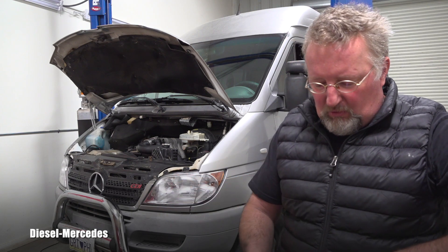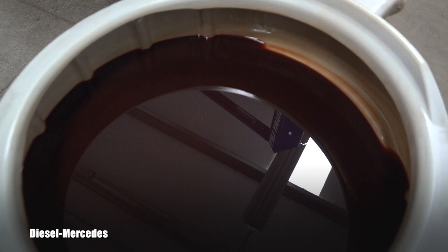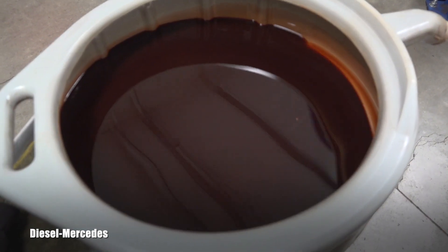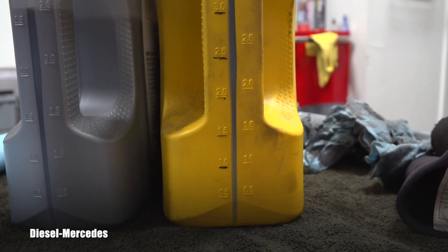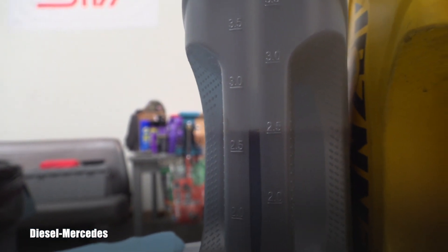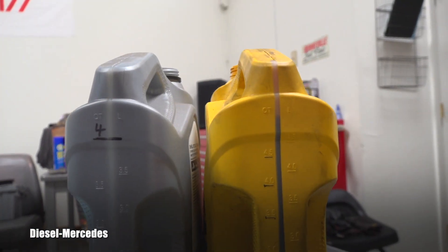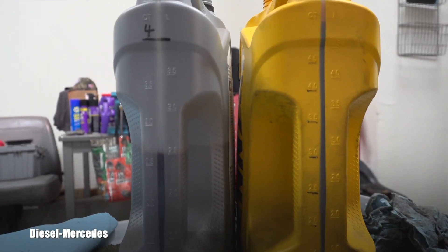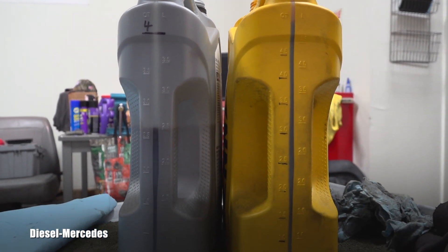There's a bunch of fluid in there. After that I will not film putting it back — that's just common sense. Here is a quick look at the quality of that fluid — I would say average contamination, not so bad. Draining the transmission took five quarts and the torque converter two point six or two point seven quarts, so together about seven point seven quarts, a little shy of eight US quarts total.